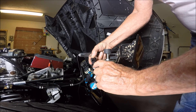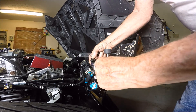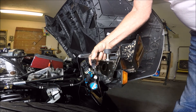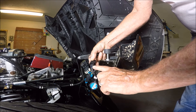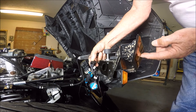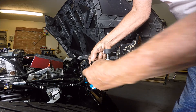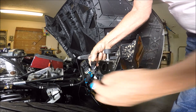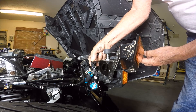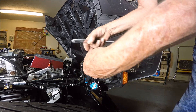The center lead is a ground. The battery voltage will go through the LED here and to ground. We also have a side marker lead right here — it lights on and stays on the whole time. That's what we need to keep the side markers going while the flashing front light is indicating our turn signal.